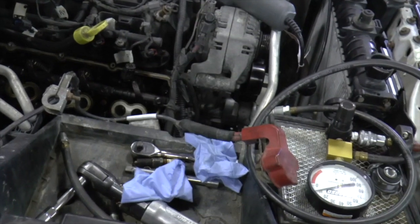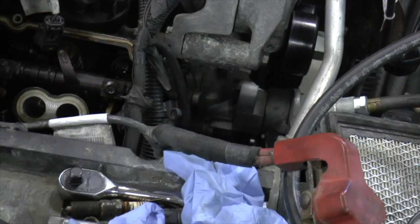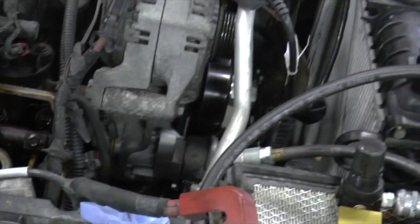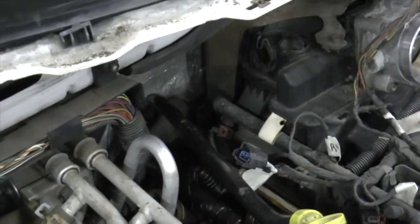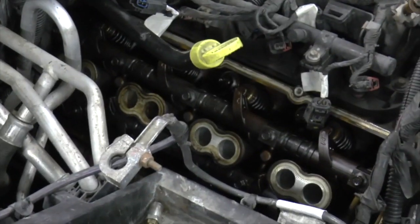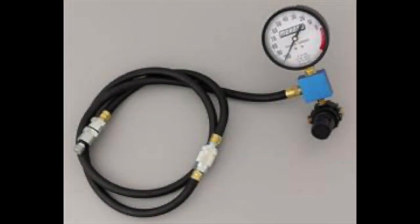For this job you'll need access to the engine pulley. I have removed the valve cover, one spark plug from each cylinder, and other needed parts. The valve covers could be left on to do this if you wanted to do the test with them on. I'm using the Moroso cylinder leakage tester for doing this job.